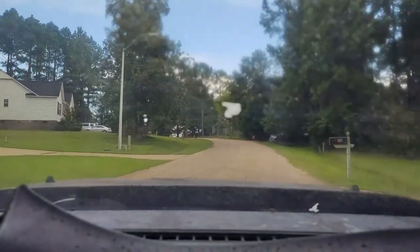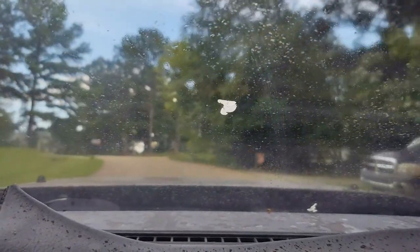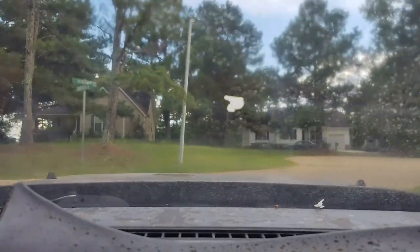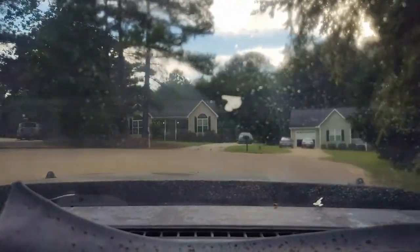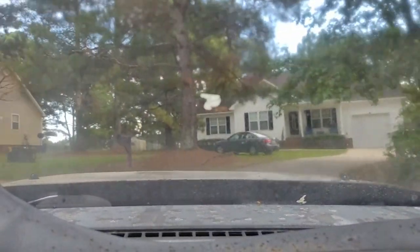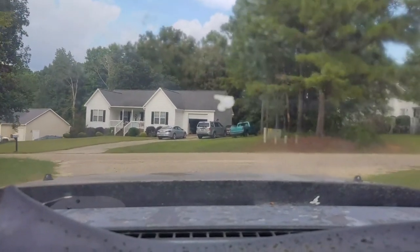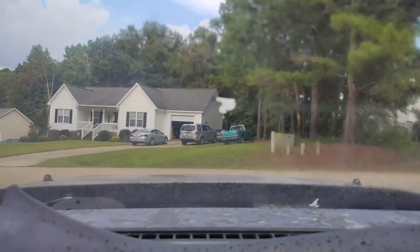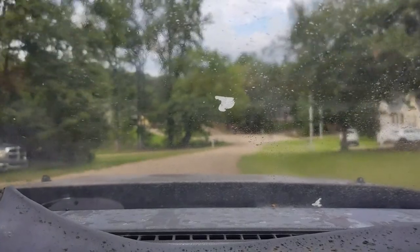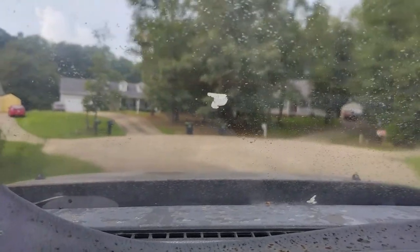Well, the clutch doesn't work too good. Definitely gonna have to adjust the pedal on that or bleed it some more, but hey, at least the car's moving. Brakes work. Clutch is definitely touchy because the adjustment's right at the floor. But seems to be pretty good.